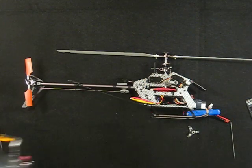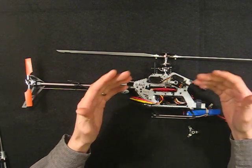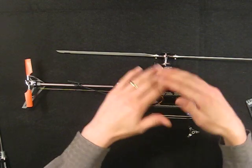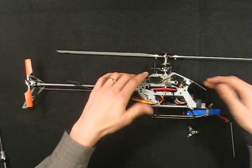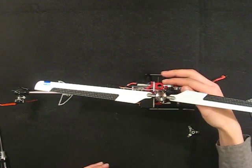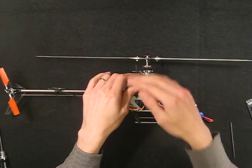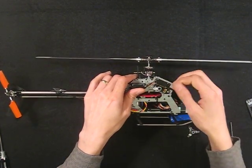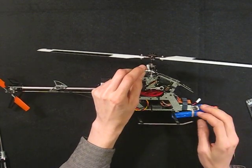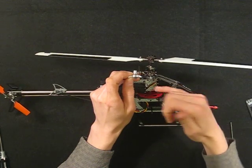Do that on all your servos. Using your radio, you can use the stick and go left and right to select one servo at a time. Here's the important part — I think this is where everybody gets confused. When you go to one particular servo to adjust it to 90 degrees, all three of the servos move away from their reference position. So as you're working your way around the head doing each servo, you get one to 90, then you move to the next servo — it'll jitter. You get that one set to 90, but remember this one is still sitting there, not at that reference position of 1,520. They're all basically waiting for where you decide to stick it at level.